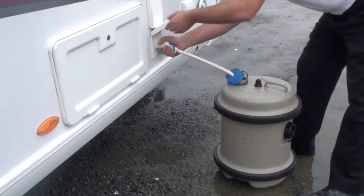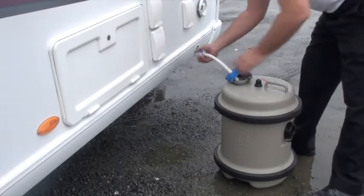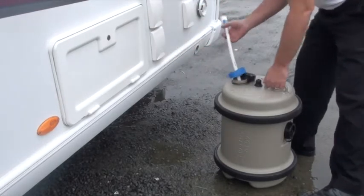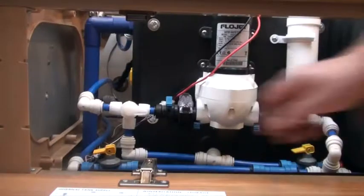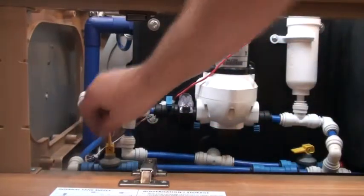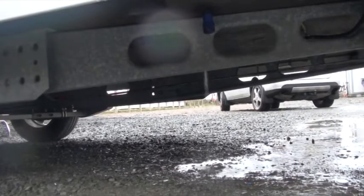First, in the case of a touring caravan, disconnect any water connections outside, and this will make sure that any one-way valves are operating correctly in the water socket. Then simply turn off your water pump and open the dump valve here to the water heater, and that will make sure that that's drained also.